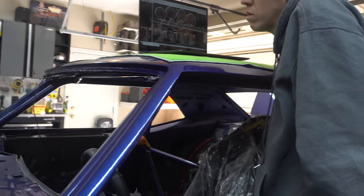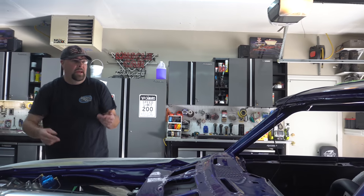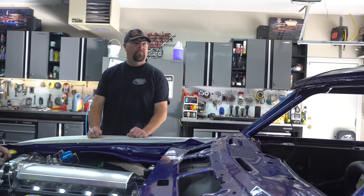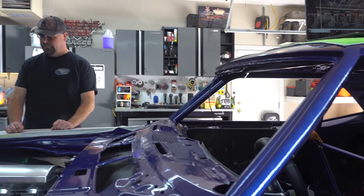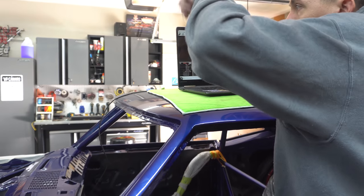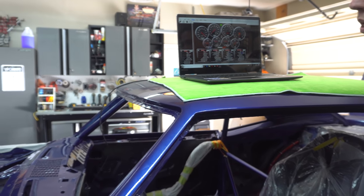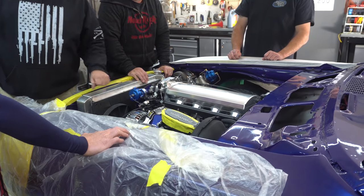How many sensors can you hook up? It says a few. Oh, you can. Okay. The Holley has probably 15 or 20 inputs for 5 volt. Well, I know, but the one wire comes out for that CO2. You just make a distribution block. So you can come off, it doesn't matter. That's what we did, a whole bunch. You would think you would overuse it at some point, but then you just tie into some other side. I would guess the amperage is very low.